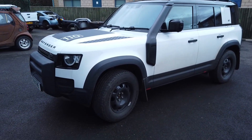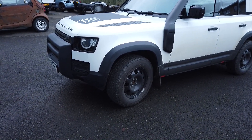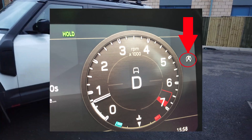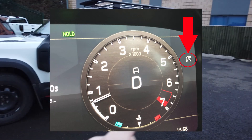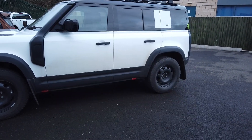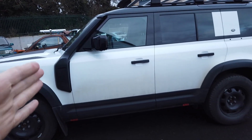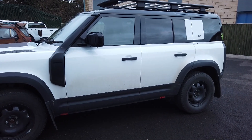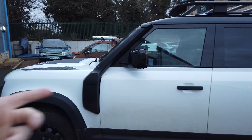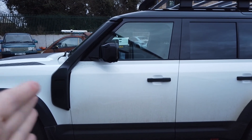Been out for a drive — just come back, just a half-hour drive. Went up the dual carriageway, came back through town. I was trying to get the stop-start to kick in, but it's not having stop-start at the moment — that may be because the battery's not fully charged, I haven't been driving it much. I'll put the picture up to show you where you've got no stop-start and I'll read the operator's manual on why that doesn't work. So I've parked it and locked it now, it's four o'clock. I'm going to leave it for half an hour — I want to see how long that overhead console module takes to go into sleep mode, so it should be getting a static sort of 12 volts, but at some point I'm expecting it to go into sleep mode.